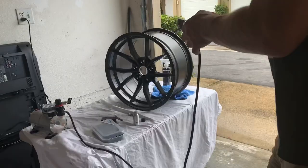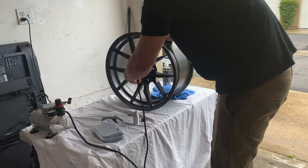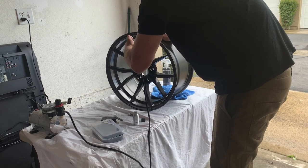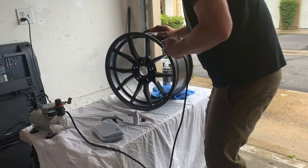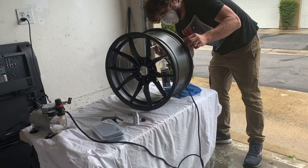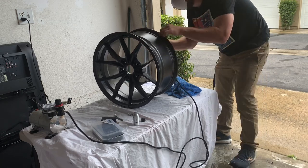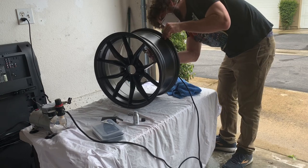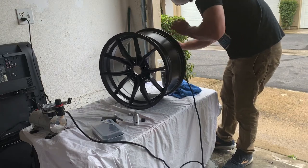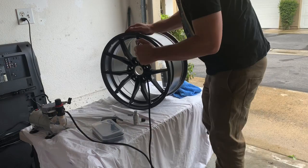The best way to do this — and in my opinion the only way — is with an airbrush. I've got this little kit here; the Master Airbrush cost me about a hundred bucks for everything and I think they're cheaper on Amazon right now. The only issue is if you don't have a really good solvent cleaner, the airbrush attachment breaks quite a lot, but they're only $25. I replace them every four to five months because they get clogged with coating. By having the airbrush you're spraying a fine mist which can reach into all the cracks and crevices, including on two and three piece wheels where you can't physically coat the bolts that hold them together — but with this you can.